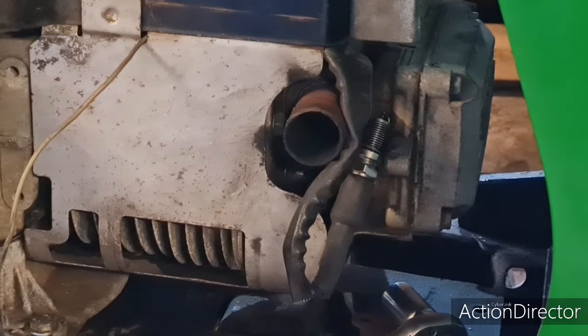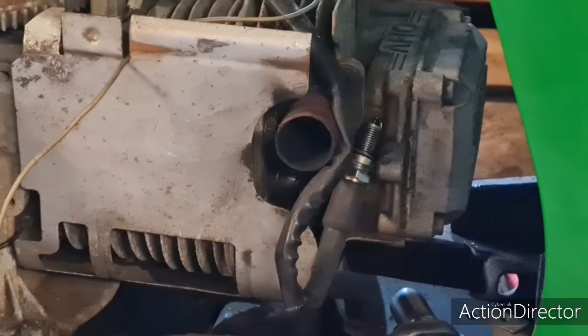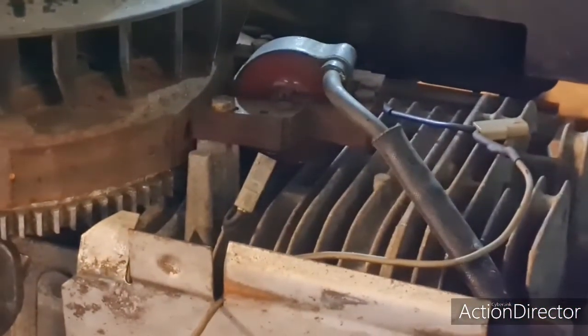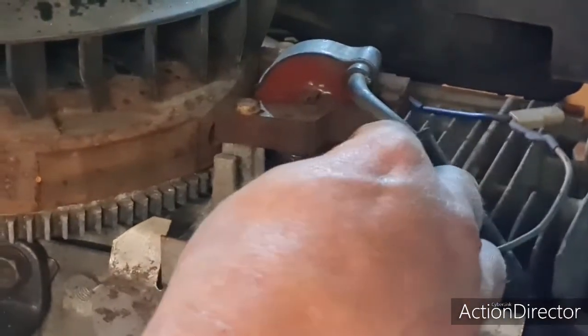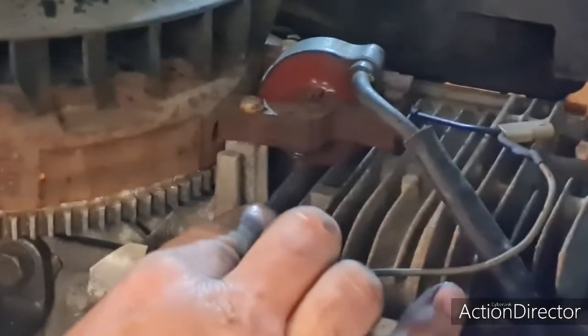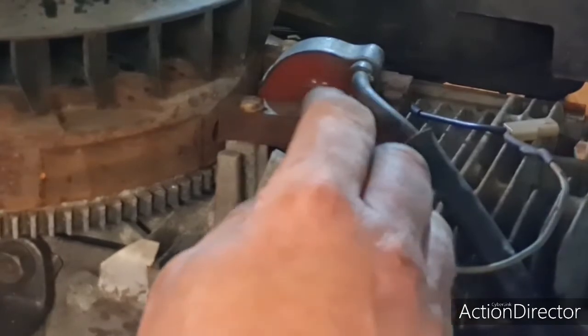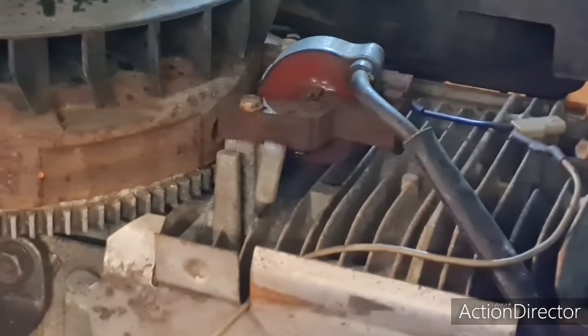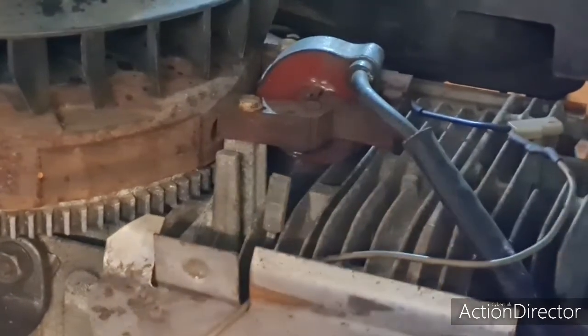Let me put another kill wire on there and then we'll be back. There's our little kill wire which I've disconnected. I think this has gone to ground somewhere because it goes right around the edge of the cylinder jacket. I'm wondering if it's either rubbed through or got caught, because I can pull it but in theory this shouldn't even be connected to anything.